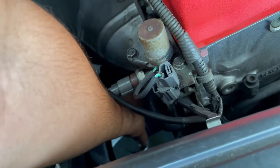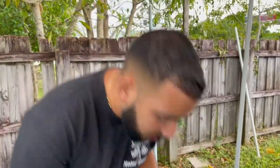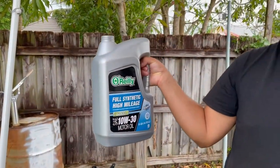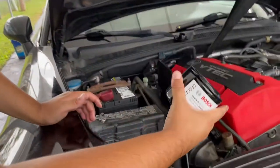Alright, once you put the drain plug back in, you want to go in and grab your oil filter. I'm using a Bosch oil filter. I also got my full synthetic 10W30 — sponsored by O'Reilly's, not really, but O'Reilly's if you want to sponsor me, let me know because I buy a ton of your products. Whenever you're doing an oil change, you always want to lube up the O-ring — just put your finger in the oil and lube it up. Then put your filter back on.